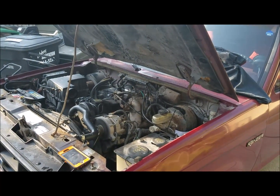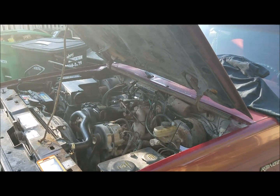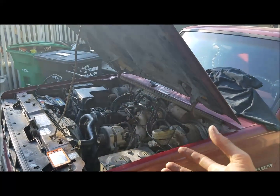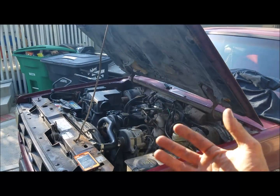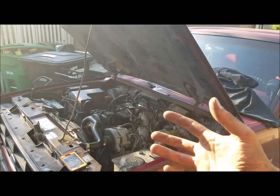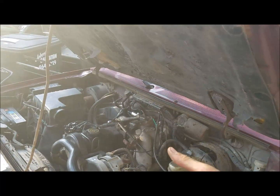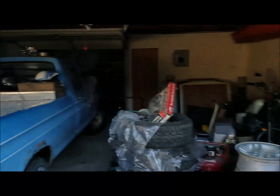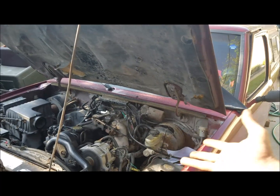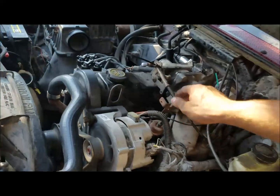Overall it's just better. A lot of people on the forums will say it's going to lead to detonation, but unless you have a lean problem with your engine, your detonation is kind of controlled by your cylinder temps, which is controlled by your fuel charge. If you're lean, obviously that lean charge is going to cause hotter cylinder temps, but this mod shouldn't damage your engine in any way, shape, or form. I do a lot of small block Ford stuff — I'm a big V8 guy — and this is just going to be my little economy daily driver.